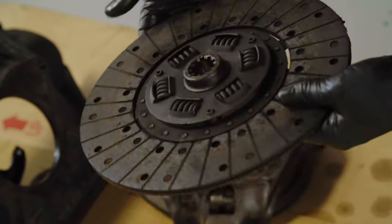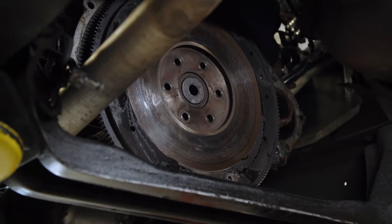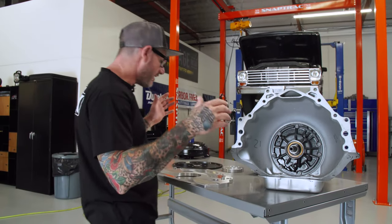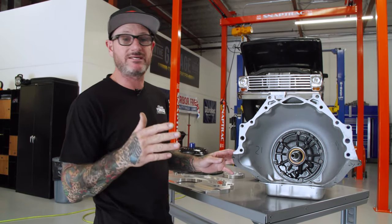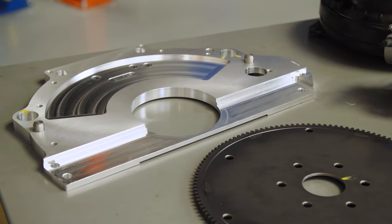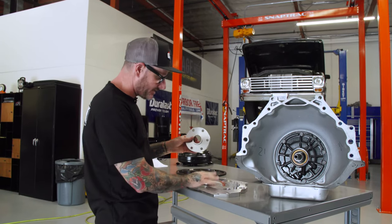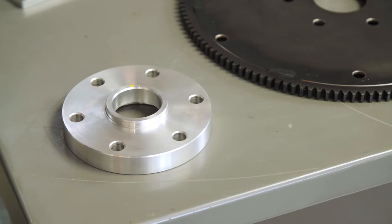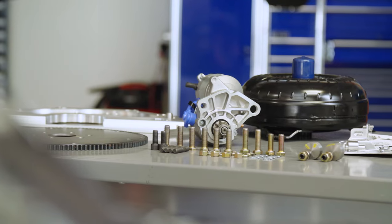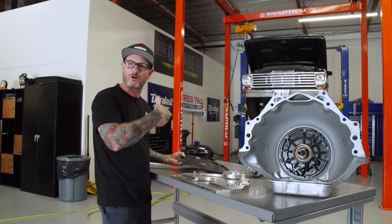Someone treated the clutch pretty well - I know I did the few miles I put on the truck. So how we're going to adapt our GM transmission to our FE engine is through a company called Wheelcap. They make an adapter plate that lines up all the holes, dowels, and bolts needed. You've got the adapter plate, a spacer that takes up the space for your torque converter and flex plate, a modified Mopar starter with the nose cut off, and an internally balanced flex plate. Everything needed is here by the truck.